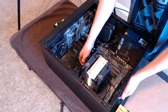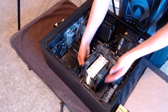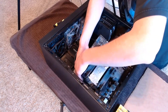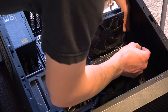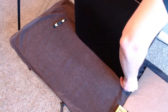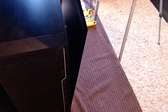Now it's time to remove the motherboard completely. Take your time with this process as the underside of the board can be scratched, bricking the device. I have cables tied to the rear of the case preventing me from removing the board — never force components. Always take the time to look around to see if there is anything additional mounting the board to the case. After examining and flipping the case over, I spot the problem: twist ties are preventing the board's removal. I separate the twist ties, replace the panel, and the board is free.